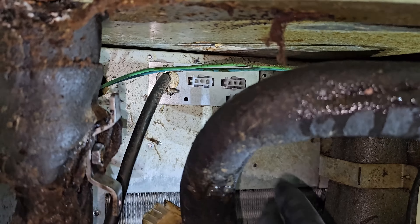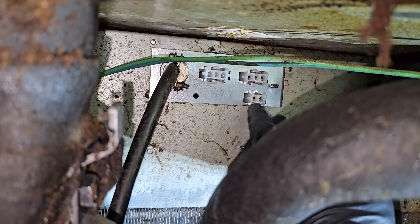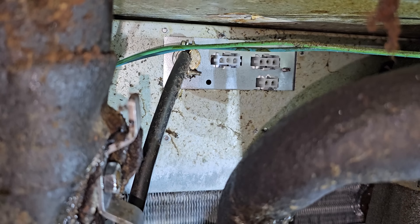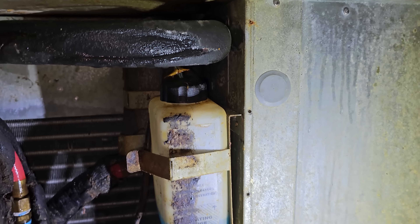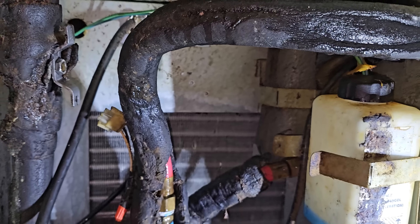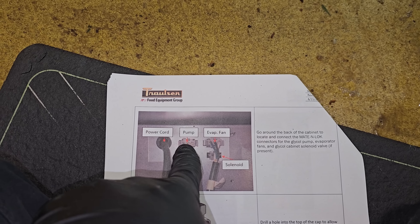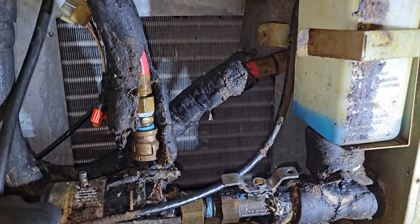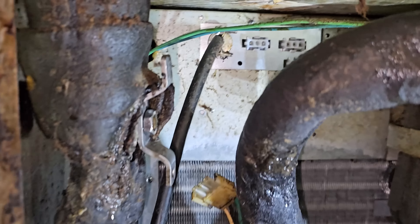The hardest part about mounting that box was that the Molex plugs kept hitting the bottom metal panel, but I got it figured out. I'm going to run new sensors — they sent me new ones and even though the old ones might still be good, I'm not taking the chance. One thing I like is that the instructions tell you which plug is the pump and which is the EVAP fan. I unplugged them and didn't pay attention, so now I know: the one going into the box is the EVAP fan, and the other one is the pump.